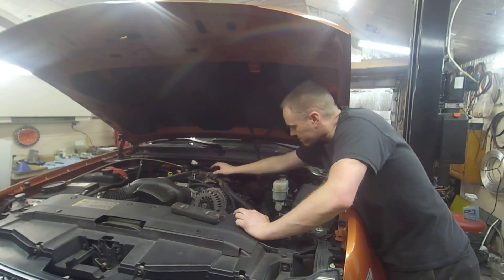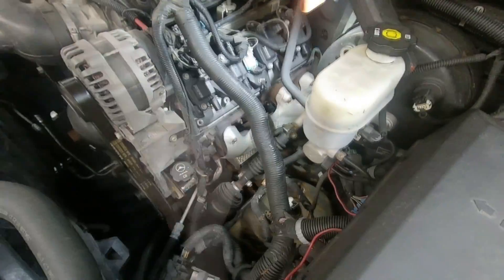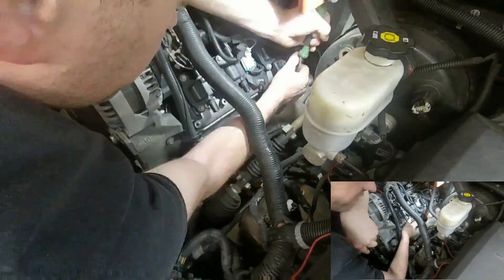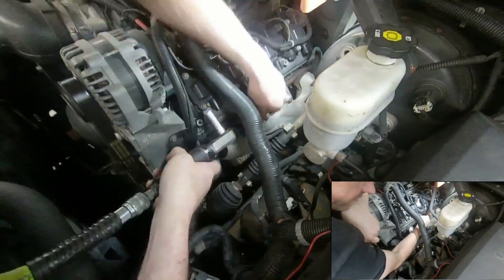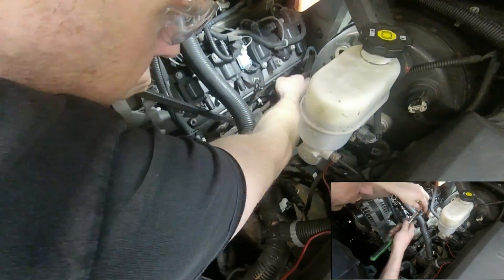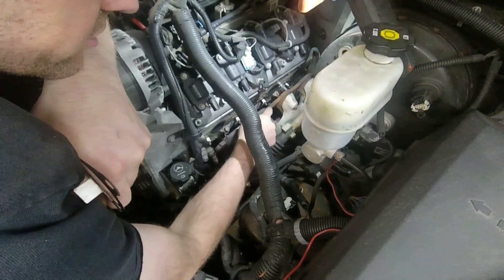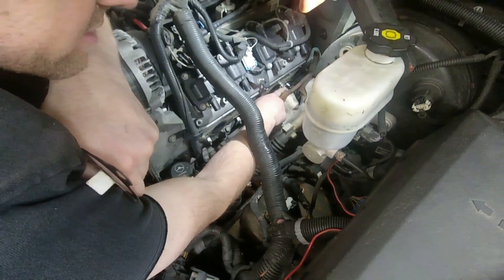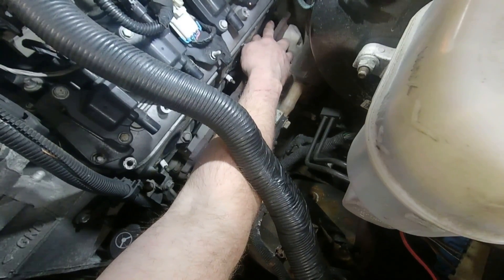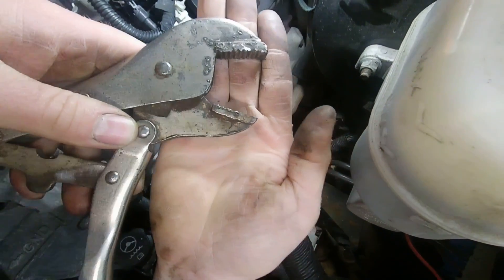First thing I'm going to do is pull these spark plug wires out of my way. I'm going to attempt to take the bolts loose without removing the plugs and leave the other side attached to pry the manifold, in order to get at the broken stud. Hopefully I can get it with pliers and don't have to pull the whole manifold off. I went ahead and pried it away after getting those off — you can see I have a socket sitting right here so I can get at that very back stud.